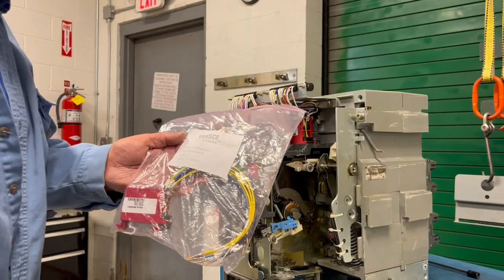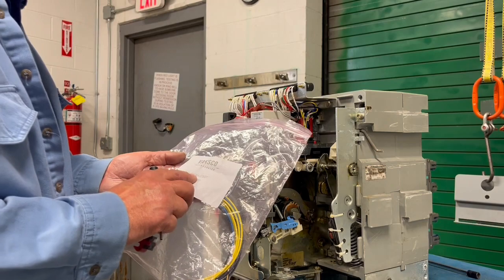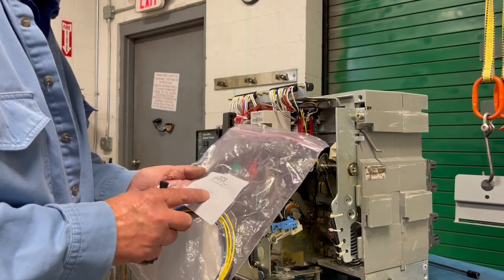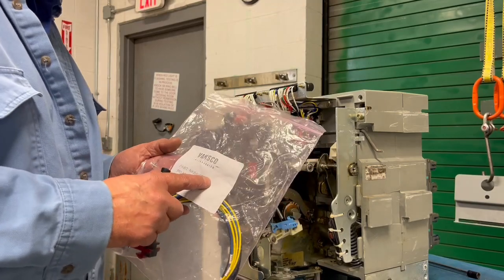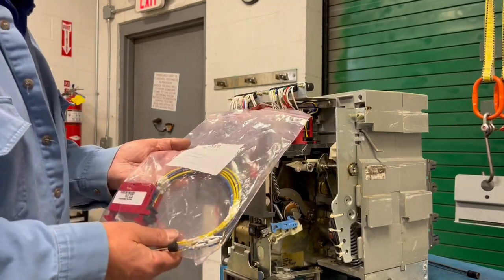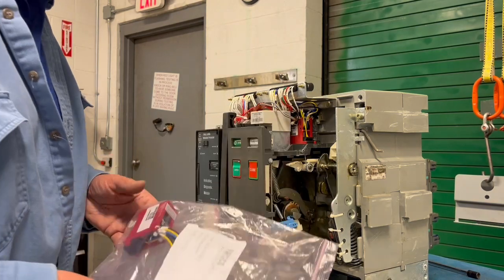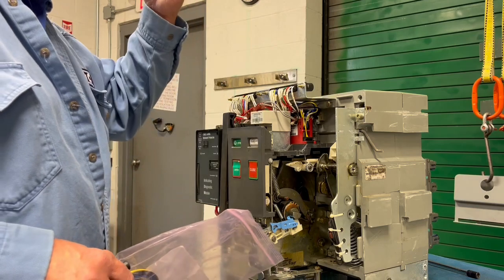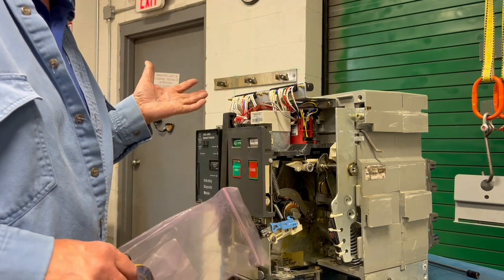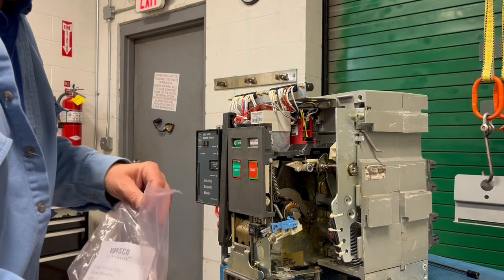Today we're going to change the D1 auxiliary switch assembly, which is the NKB4003 G11. The A1 auxiliary switch assembly is the G03 assembly. The group 11 is all your spare auxiliary switch contacts. The group 3, again, is for your closed circuit, your trip circuit, as well as your 97, 98 for the B contact for the relay. But we'll start with the G11, okay?